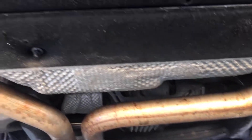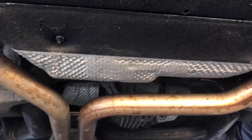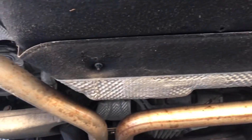I know we already discussed that you don't need to cut the air lines from down here, but because I was down here anyway, I highly recommend removing this and cleaning up the manifold and air compressor. After years, stuff gets caked up in there, so it's good preventative maintenance.